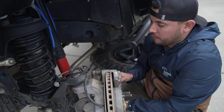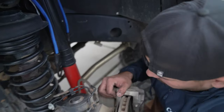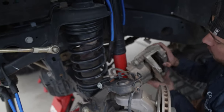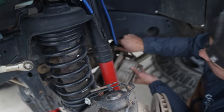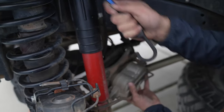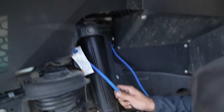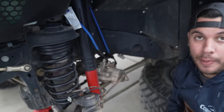When you're taking the brake caliper off, you don't want to put any tension on the brake line — it pulls right off. You're going to rest it over here and also attach it with little bungee cords that slip through here and hang up on the tower, so that's going to keep all the tension off the line. You can see it's nice and out of the way now.